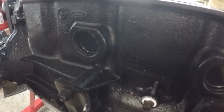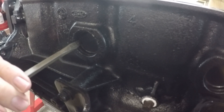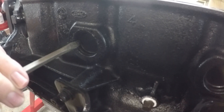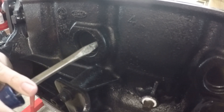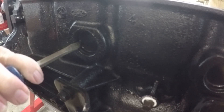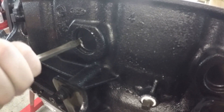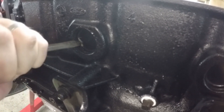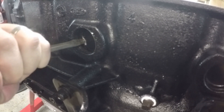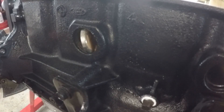Alright, let's go ahead and get started. We want to take our flathead screwdriver and get it on the side of the freeze plug. We're gonna hit it with the hammer — that side is gonna push inwards and this side over here should pop out. You want to try not to let it fall into the engine block; you want it to flip out, and then we'll grab it and pull it out with our pliers.